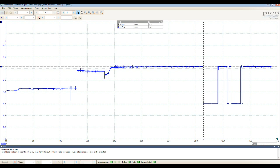Yeah, so I disconnected the VA from here to here, went key off, then key on. With key on, I unplug the connector and we can see I get the same voltage in between here and here, and plug it back, and that's what I get. Unplug, this one still should produce that voltage.